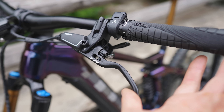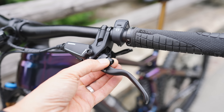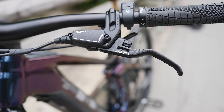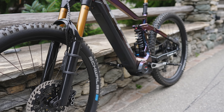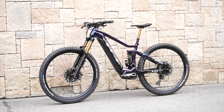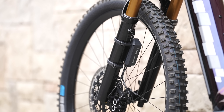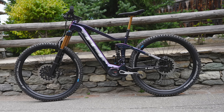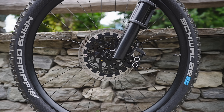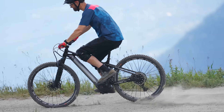The levers are made by Magura and are adjustable for reach — pretty long levers on there. Here's the reach adjuster and the little master cylinder. For the ABS, here's the control unit just there. The entire system only adds 400 grams to the entire bike — that's for the control system itself, the extra wiring, and the extra little sensors on the brakes. It's not a huge amount of weight to add — 400 grams to a 23-24 kilo e-bike is not a huge amount. Bosch ABS is super interesting and will no doubt polarise a lot of people. I've got a full test video on Bosch ABS coming out real soon, so make sure you're subscribed if you want to be the first to see that.